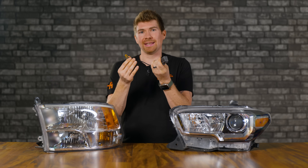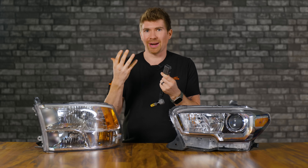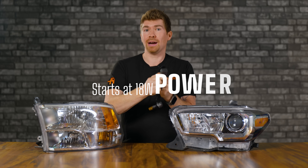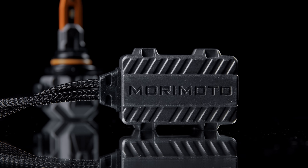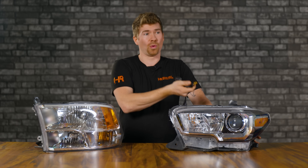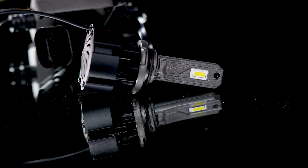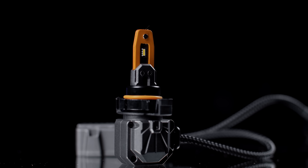We're going to test things a little differently today, because there's a little party piece this bulb has — the driver. This driver actually ramps up in brightness. It has a conservative startup of about 18 watts of power, and after 15 minutes it's got 22.5 watts of power. So this LED bulb slowly gets brighter over time. At first I thought that was silly — why wouldn't you want full brightness at immediate startup? But we don't actually drive for only 45 seconds. We drive for 10, 15, 20 minutes or longer. And other LED bulbs — even the Ultra 2 — all lose brightness over time. So a bulb that slowly ramps up might actually be good.